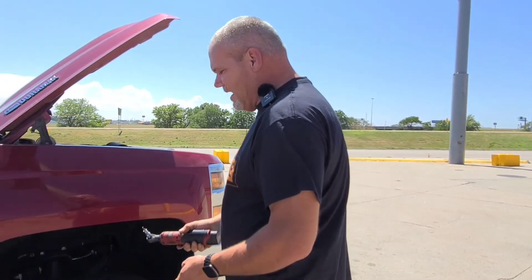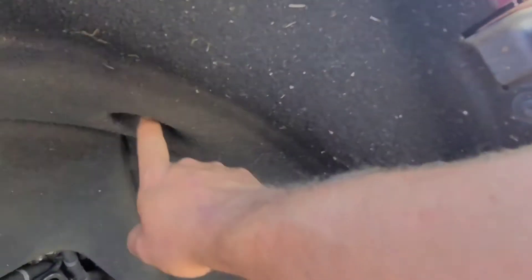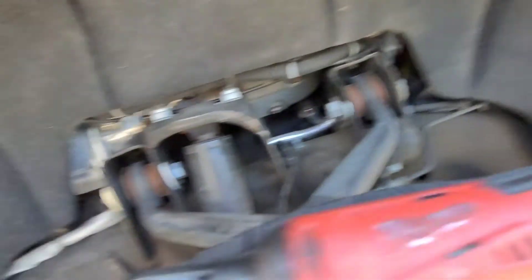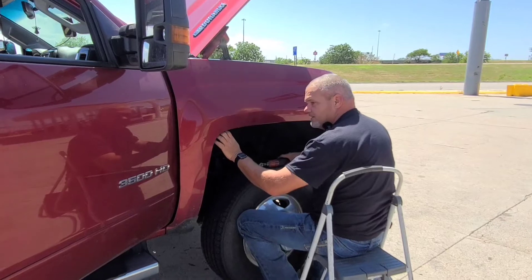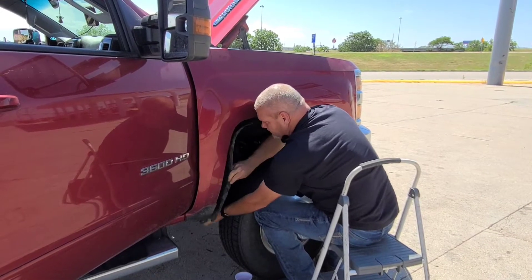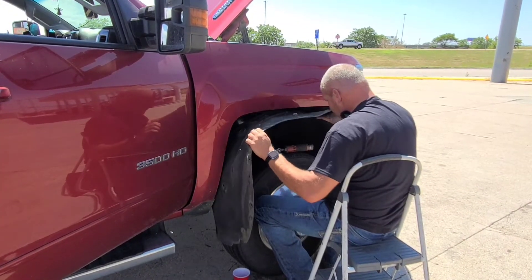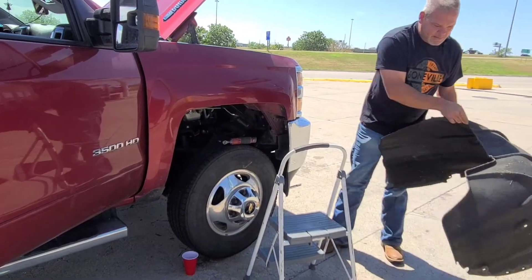Always make sure you've got it on loosen. When you're taking the inner fender liner out, there are Torx bits — you want to get all of these out. There are some in hidden places: one right here, two right here, and one right here. Just make sure and look for all the hidden ones you can find. Now I've got all the screws out, we're going to go ahead and remove the inner fender liner, which is not that big a deal — I'm sure most of you guys have done it before.